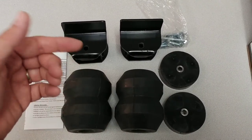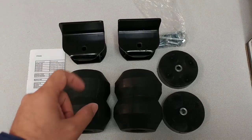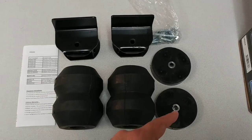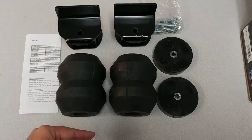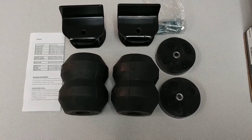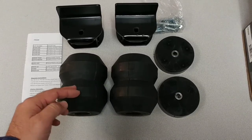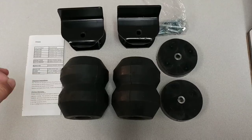The two mounting brackets are going to replace the factory bump stop mounting brackets. These bushings will mount to those and they'll replace the entire factory rear bump stops. The spacers are designed if you want this portion closer or further away from the contact point on the rear axle. On some trucks you'll have a spacer block with a metal bracket that sticks out that makes contact to these, such as on my previous 2011 F-250 and your single rear wheel trucks.